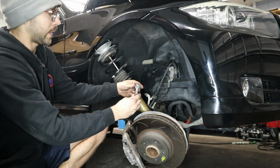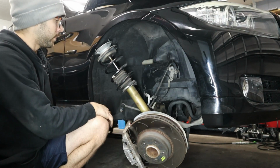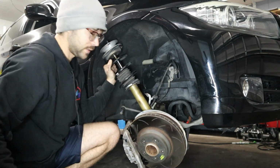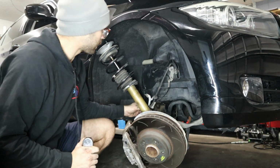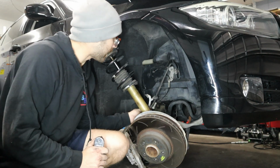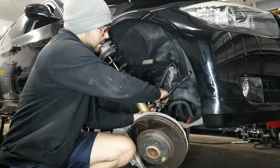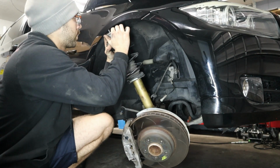Now with this bolt out of the way, we should be able to swing the strut out, remove it. Let's see if it's loose in there. Oh no, it's not. So this is a spreader socket. I'll put a link to it in the description below, but it's made for this. It's supposed to widen that gap there so that the strut can come out nice and easy. There we go. All right, so we'll swing this out.